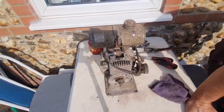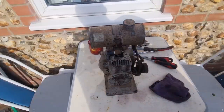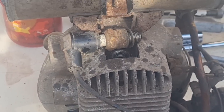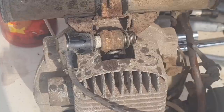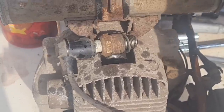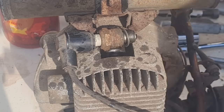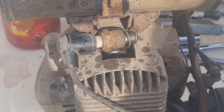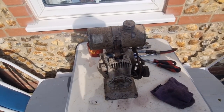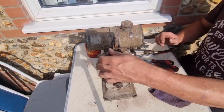I'm going to have to get out of my seat for this and come round here. Can you guys see? I need to make sure you can see this spark plug. Tell me if we've got a spark there - yes! Yes! With a swift pull like that we did have a blue spark. Well that's good - that is very good. That has saved us having to take this flywheel off. We've got a spark, this is brilliant!